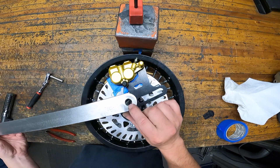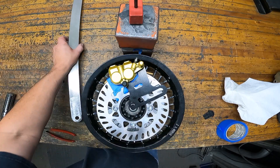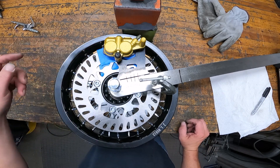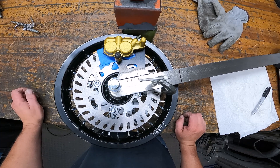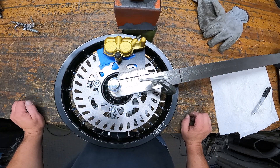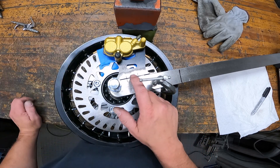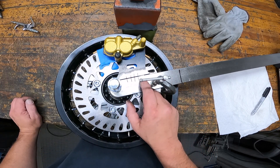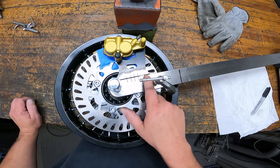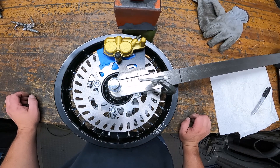I've got this 15 millimeter hole drilled in the end of this piece of 3/16 flat stock and then radiused. I marked and cut off part of that existing bracket that came with the caliper and ground it so it would all match up to this extra piece I'm making. I've got everything lined up where I want it and marked some reference lines so I can clamp it down, put a couple tack welds on it, then cut off this extra length, mock it all up again, make sure it's all going to work, and then finish welding it.